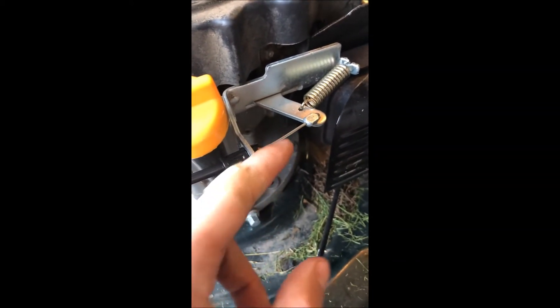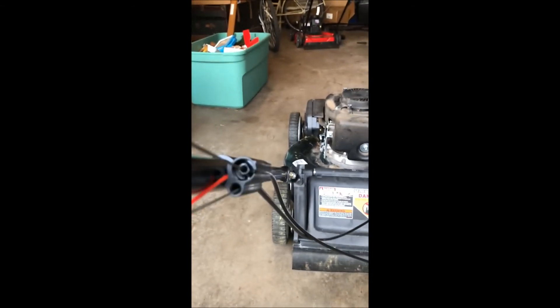What I did was pull it off, extend the cable on both ends, then douse it in WD-40 and just kept working it back and forth until it got easy to move again. As you can see, now when I pull the throttle cable you can actually see it moving, so it'll disengage that stop and we can actually get this thing started. I put the good end down here so it could pull back and forth easier, and the cruddy end up top — but after getting that WD-40 in there it made a world of difference.